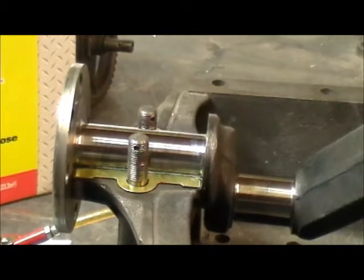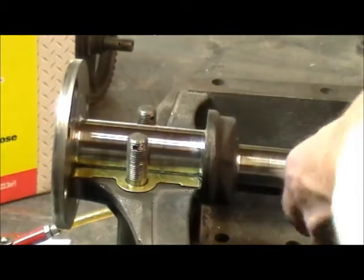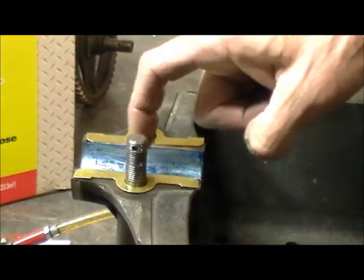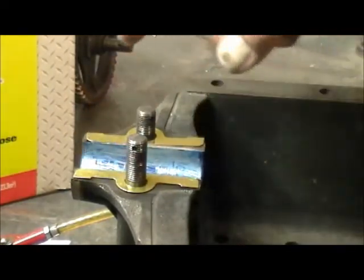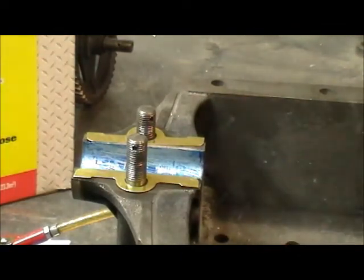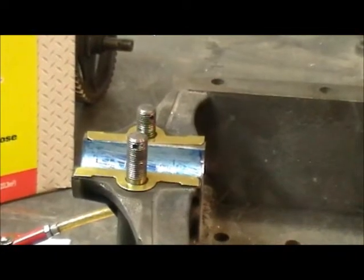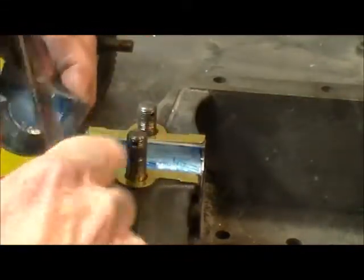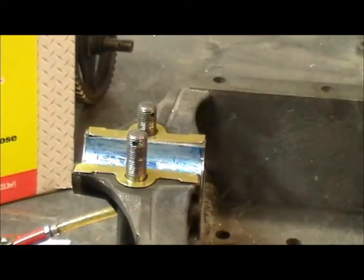Taking the crankshaft out — I'm not getting much contact in here yet, just a little bit, but I can see I'm still rubbing along this edge right here. So I'm going to take my little knife and wherever it came off, I'll take a little bit more away so we can get better contact on this surface down here. Looks like we're rubbing right here on the cap as well, so I'll just carve a little bit out there. There's another little spot up here too.